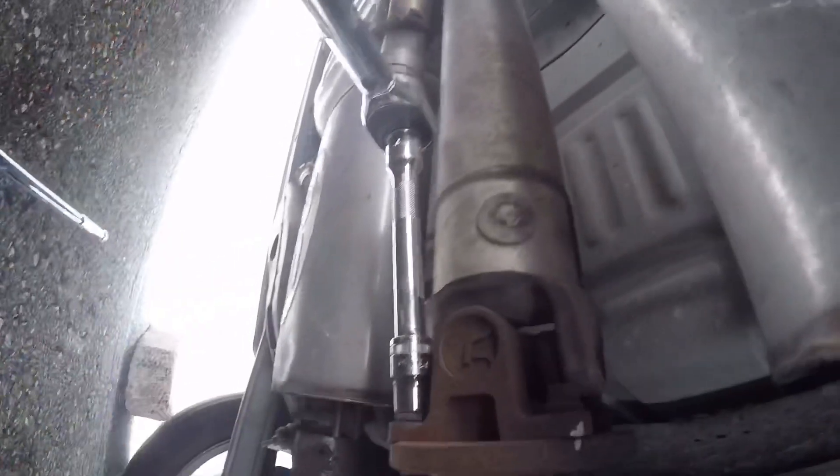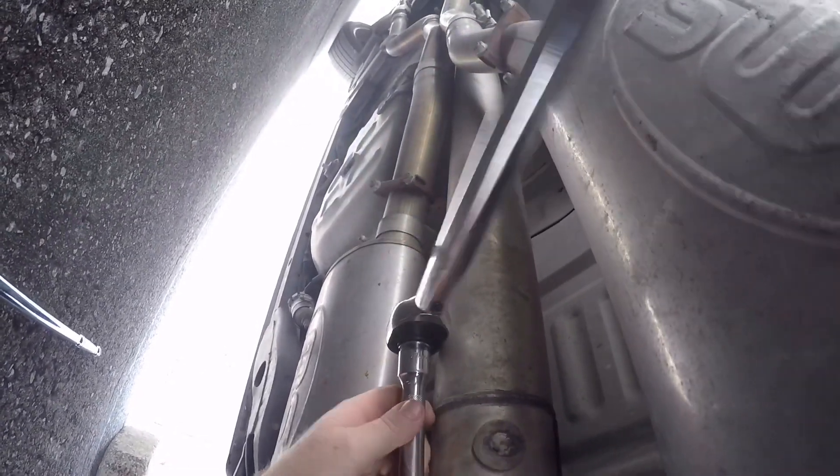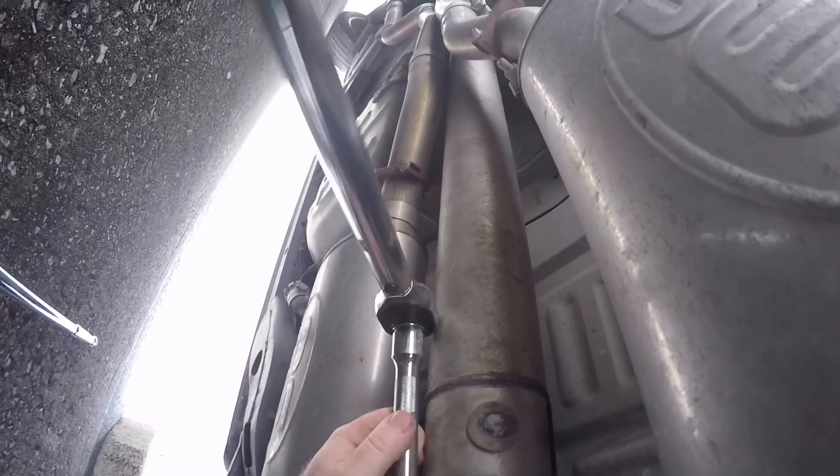Alright guys, I'm under the car here — it's hard to see, very awkward positioning for this drive shaft. First thing I noticed is the drive shaft bolt is not all the way in. I put the wrench on it, barely turned it, and the bolt came loose — that's just not right. These are supposed to be torqued down and I barely did anything and the bolt just broke loose. I'm going to pop all this out, get the drive shaft out of here, and then we'll work on the U-joints.